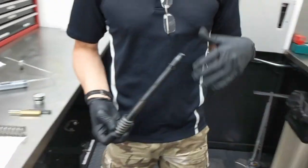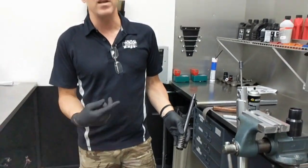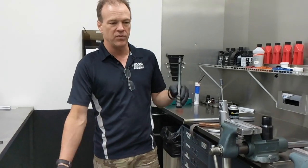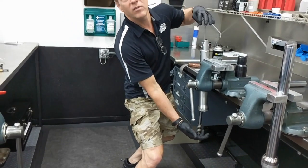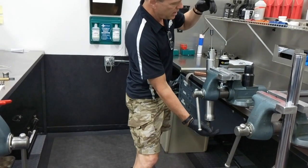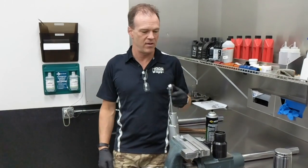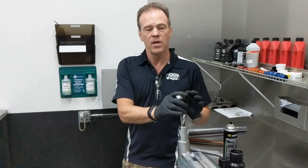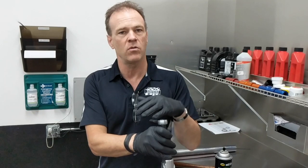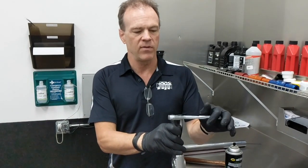One of the tips for installation: you would put the rod back up in the fork and you'll just need to find anything around the house a couple feet long that you can poke up in and hold this up in the fork while you start the nut thread and tighten it back and get it tight again. Torque spec — we use the torque spec. These bolts have a copper crush washer under them, so it will seat and crush the crush washer. The crush washers are fine and reusable. If it wants to turn, it's not tight enough.